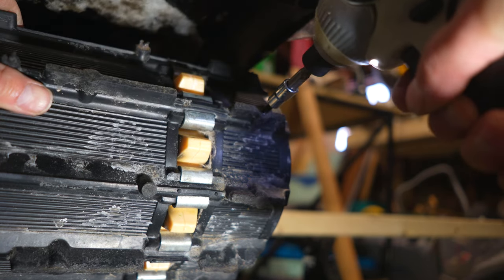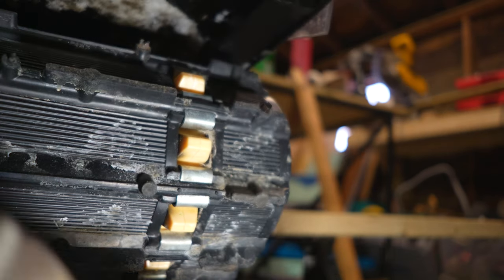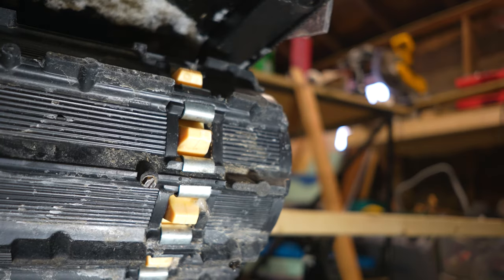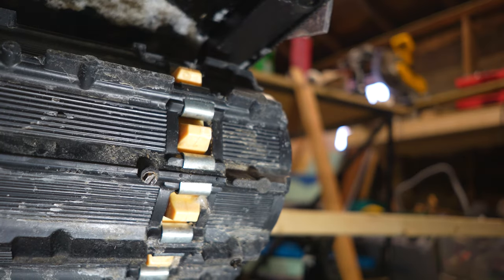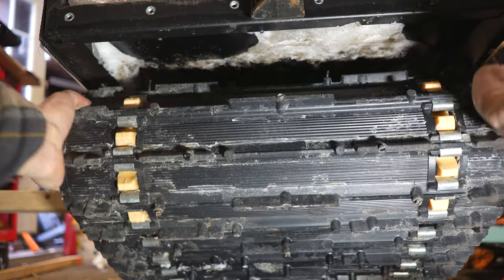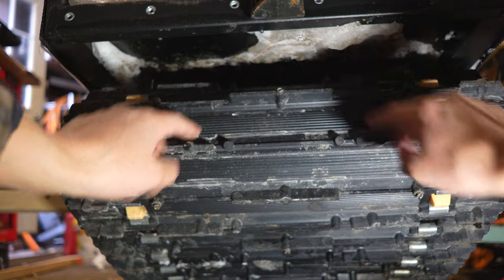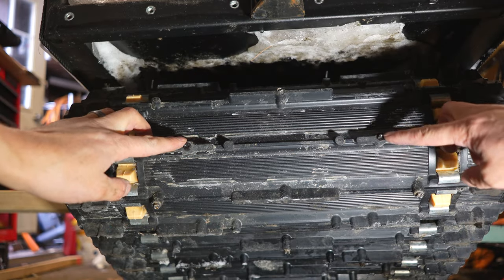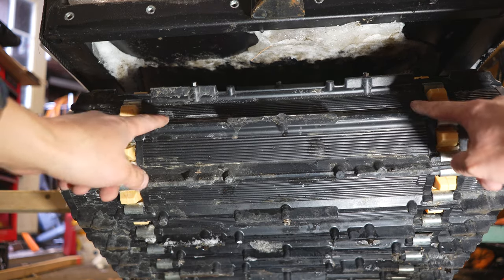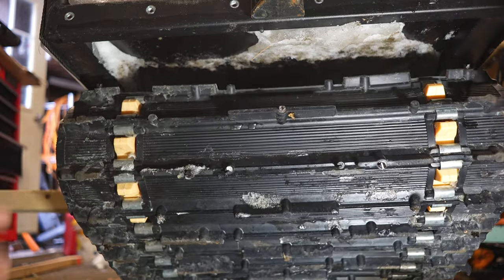The reason I'm doing this is because I feel like sometimes I don't have enough traction. This comes in a bag of about 250. I'm going to do a V pattern and stud this a lot more than it already is. Start with a one, skip a lug, then one track down and do two. Then another one further out, next lug out, next lug out, then back to center — and I'm going to keep doing that all the way around.